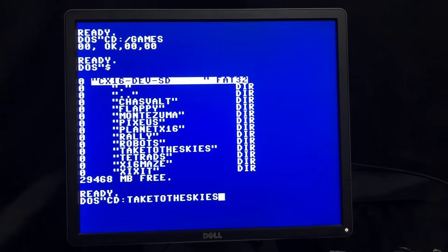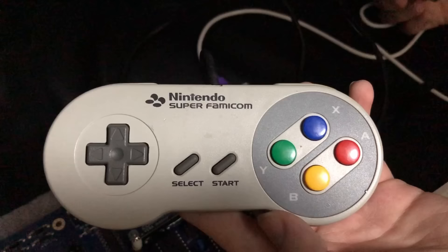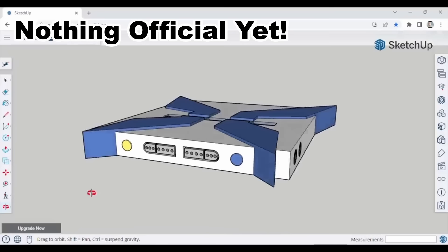But we're still dealing with an 8-bit machine here. Listing a directory can go over the total screen height, and trying to get a good look into the right directory is always going to be harder than just double-clicking a file. While the X16 does support Super Nintendo controllers, they plug into the back away from you — same with the keyboard and mouse — so you'll be wrapping your cables around the machine. The unofficial plans for the Generation 2 board look like they address this by putting that out front, but it's something you'll have to deal with on this model.